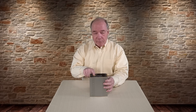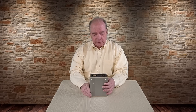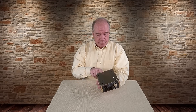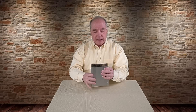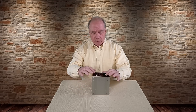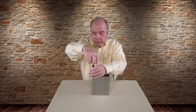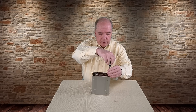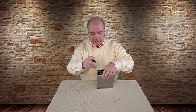The fan only seems to come on when I'm using the electrical outlets and drawing current for a period of time — it may turn on to cool the electronics inside. I've got four screws on the bottom and a number on the top. My suspicion is there are printed circuit boards inside that those screws are holding against the heat sink. On each end, I've got four Torx screws — they look like T20s. I happen to have a Torx driver and it fits perfectly, so I'll pull those four screws out. I need to be careful about accidentally hitting that power switch on the back.